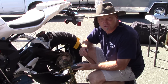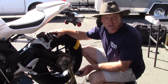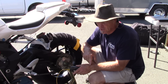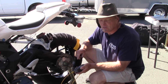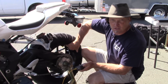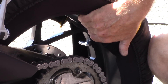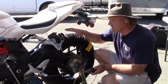One of the assumptions that causes way too many crashes is that you pull the warmers off and go out. You may touch the tire fleetingly — it feels hot — and off you go. You need to check it. Check it every three to four months to make sure that in an allotted time period you are getting the heat from the warmers through the tire to the right temperature — and that doesn't mean on the surface, that means five millimeters deep. You should also check that the wheel is warm by hand, because the wheel will steal heat from the tire until it gets hot itself, and then it leaves the tire alone.